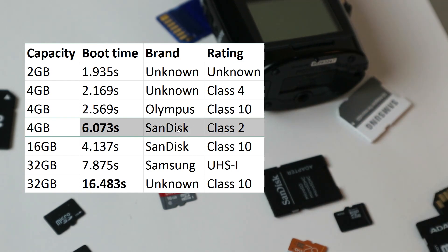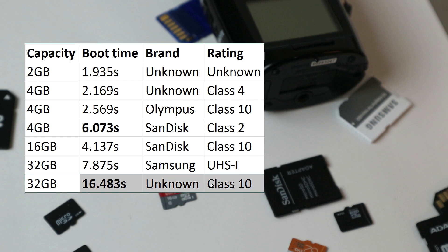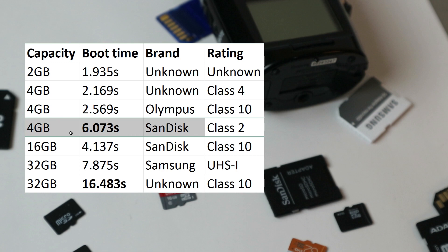The 4 gigabyte blue SD card by SanDisk — I think it's super old, class 2 — might be an indicator or reason why it was slow. Then there was the 32 gigabyte unknown class 10 card — maybe class 10 is a lie, I don't remember if I ever tested it, probably from AliExpress. Basically we have a continuous growth from 2 to 32 gigabytes: at 32 we have nearly 8 seconds, at 16 we have 4 seconds, at 4 we have 2.5 seconds. It doesn't quite make sense why a class 4, 4 gigabyte card would be slightly faster than a class 10 4 gigabyte card, and there are also statistical outliers.